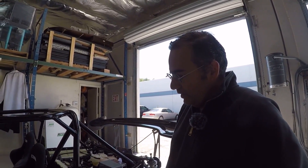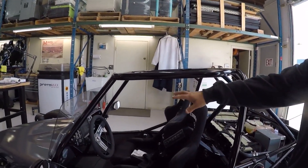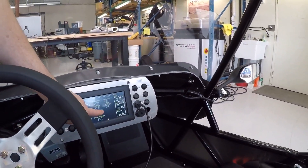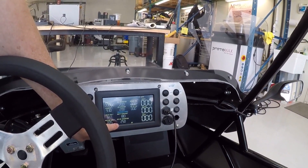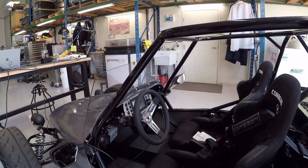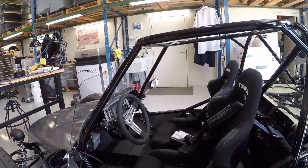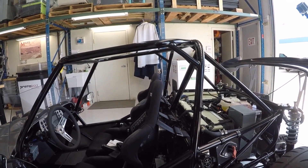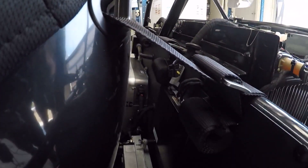The problem is it needs a fan and we didn't put one on it, so on the display it shows the DC-DC inverter temperature — that one can get too hot if we're not careful. We still need to put a fan on it. On the display you can see the bottom middle temperature: DC-DC average voltage inverter temperature — 25 degrees Celsius right now. Everything is displayed in Celsius. On the charging side, this Chevy unit is native with nothing done to it other than sending a signal. The charger uses a custom board built by Damien McGuire — you can see the right-angle USB coming off the face of the charger.